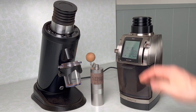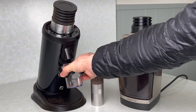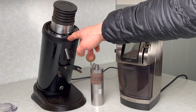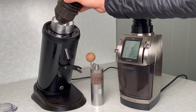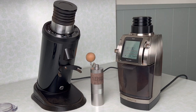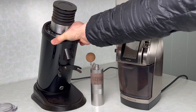This Forte has a non-stock Baratza hopper — a single-dosing hopper made by Shay with a TPU bellows — while the DF64 has more mods: a riser catch cup, tilted base, zero indicator, dial indicator, and an anti-popcorning bellows addition. The Vario also has an anti-popcorn attachment. Both grinders can be modified and upgraded to work better with a single-dose workload.